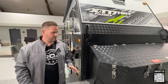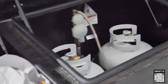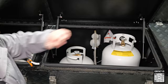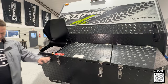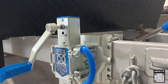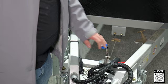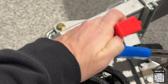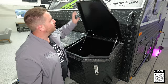You do have this storage box up front and it is massive — this is part of your annex with gas-assisted struts. This is your propane area and it comes with smaller 20-pounders, but as you can see we threw in a 30-pounder to showcase that you can put two 30-pounders in there. It comes with a heater, an air conditioner, and the 750 series Arc jockey wheel with the Cruisemaster DO35, as well as your handbrake. The Australians have designed it for America with a seven-pin connector but also given us the Anderson plug so you can charge the trailer from your vehicle much faster. There's also a storage compartment that can be used for jerry cans or general storage.